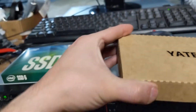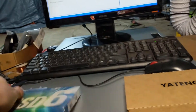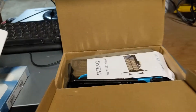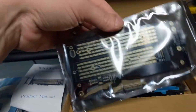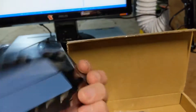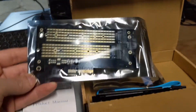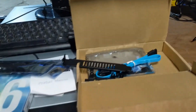I'm adding an Intel M.2 NVMe SSD using a PCIe adapter. In my last video the adapter I used didn't fit the card well. This new card actually comes with heat spreaders for the M.2 drives with thermal compound or thermal pad, which is better. It's about the same price, runs full speed, and comes with brackets for both full height and half height.